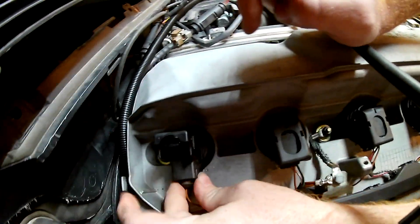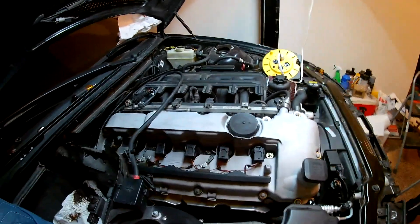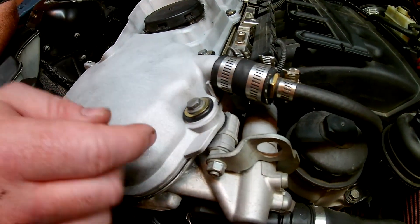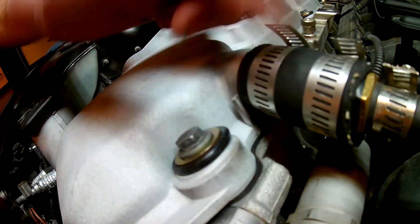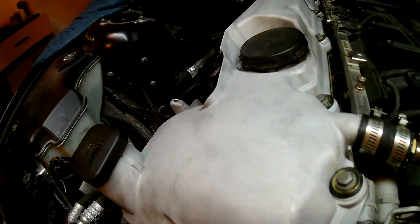That is a beautiful piece of automotive salvage history. Blake has also run the connectors — one plugs in there, the other plugs in there, coming in from the harness. That's what we soldered. As far as these washers, instead of using the old stuff, we used the existing M54 bolts for the valve cover and purchased these grommets off eBay — they're like $8 for a 15-pack. We did torque all these to spec. These are 3/8 grade-8 washers just for some bling factor. So we'll get this fired up.